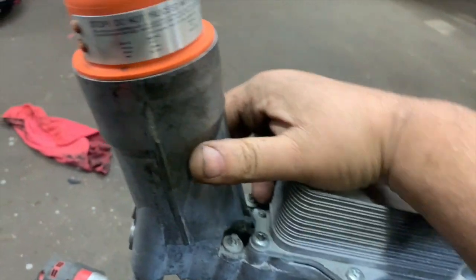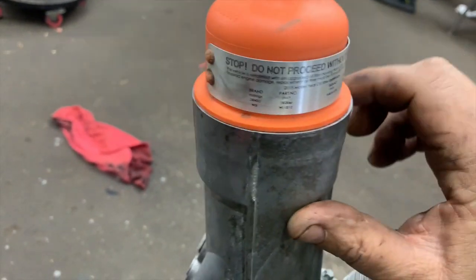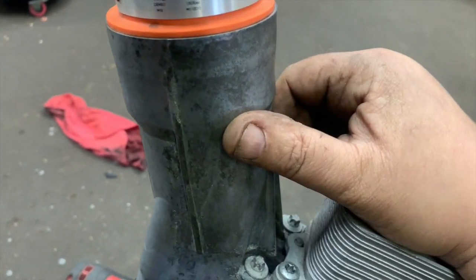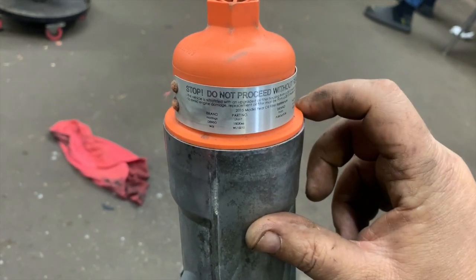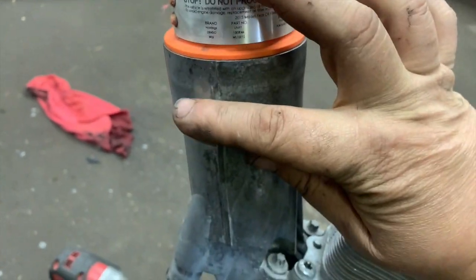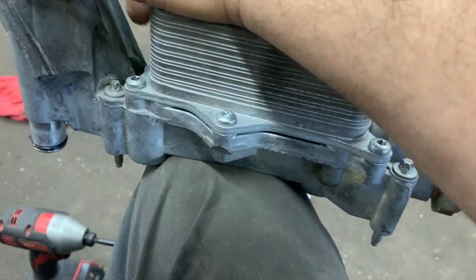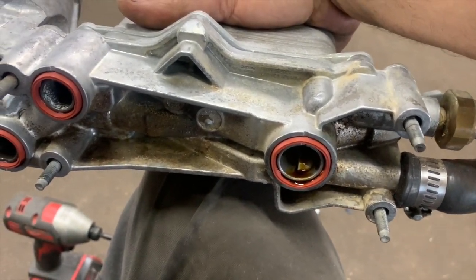Another thing you need to know about your oil cooler: if you put the O-ring under the oil filter cap in the wrong land, it will leak out the sides and back of the cap and it will mimic a blown cooler. This happened to me personally basically twice — dealers came and lifted $1,000 off of me each time early in ownership because I didn't know about this. But if you see oil on your transmission bell housing, one of the first things to do is look on the side of the barrel to see if it's actually coming down that barrel section the filter lives in, because that would indicate it's a problem with the O-ring on the cap, not the cooler itself. And there I just saved you $1,000.